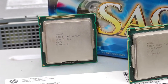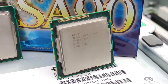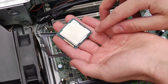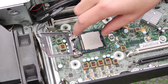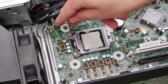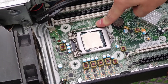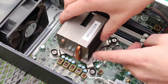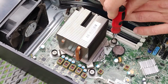You can easily upgrade the processor in this machine to anything ranging from a more powerful i3 to the most powerful i7 from the Sandy Bridge era, though I'll stick to the normal Core i3 for this. To install the processor, align the golden triangle on the corner with the white dot on the corner of the socket and lower it gently so it is seated. Then lower the retainer, making sure the tip goes snugly under the head of the screw in front of the socket, push the retention lever down gently and tuck it under the protrusion from the retainer. Then apply thermal paste and install the heatsink, aligning the screws with their corresponding holes and tightening securely, alternating between screws to keep pressure even on the processor.